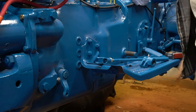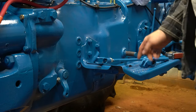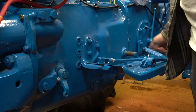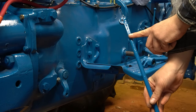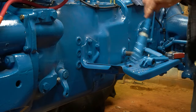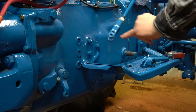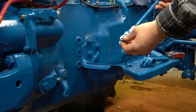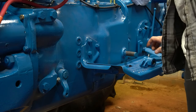I'm going to install the clutch linkage. I never installed it when I put this thing together because the rod goes through the running board. It's pretty simple to install. The pedal slides on to a pin here. The rod has two eyelets - this one connects to the clutch pedal and this one is up on the clutch release arm. This double clutch model has the double eyelet. With the pin in the front hole you're running on the transmission clutch; in the second hole you get double clutch action.